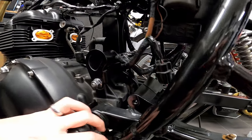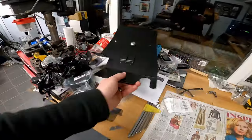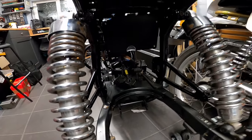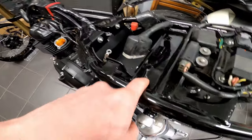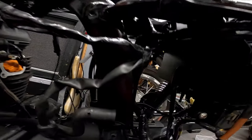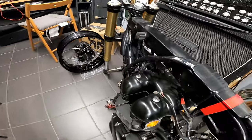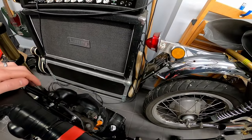The only other two things are two relays down here, and there are clips on the liner tray for those. So I'm just going to get this put in place — literally just drop that in, bolted to the back of the battery box, and then I can clip the relays in place and final cable-tie everything. In terms of the harness, I've cable-tied it in place — it's got two fir-tree clips which run it underneath on the left-hand side, and the rest runs up in there. This portion with the map sensors and the rest of the harness running forward is loose-bolted in place.